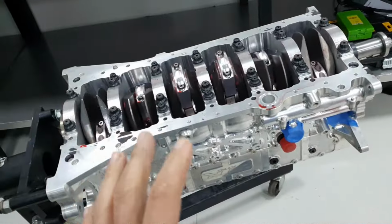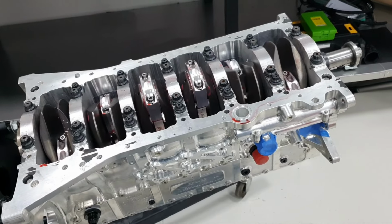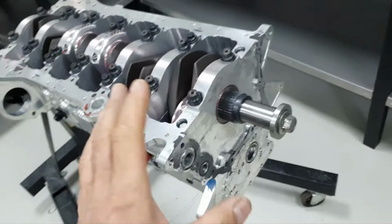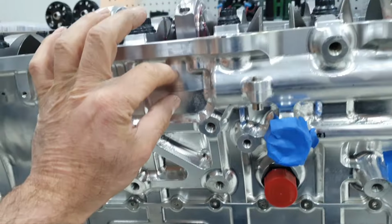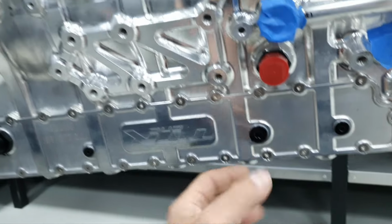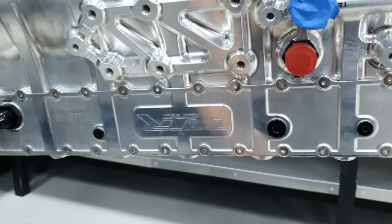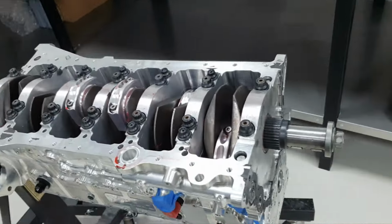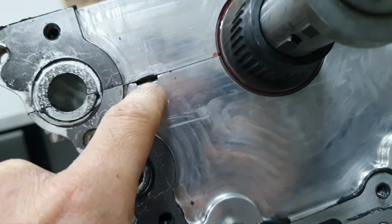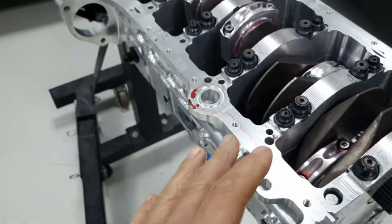Now, at this point, before I pull out, I can actually pull out the pistons. Yeah, I need to mark the pistons and then take them out. Makes sense, right? And then to make it upside down, what's my point? I don't want to split the block here and then get measurements from the cylinder. Ideal is going to be to also have a torque plate torqued down on the block, as it is right now, and then get the measurement from each cylinder. But it's okay, it's fine. Then we see here. All right, that's what I'm going to do now.